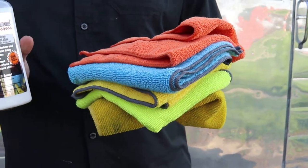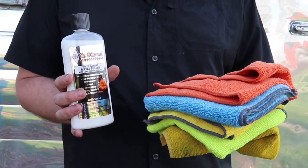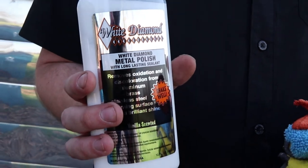Today we are going to polish out the Phoenix Camper. The camper has been in storage all winter, so at the beginning of the season before we get too busy, we do a good hard hand polish. We do that with a bunch of microfiber towels and a product called White Diamond. It's not sponsored, but it has a little bit of jeweler's rouge in it and it's also a sealant, so it lightly scrapes off accumulated grime and leaves a sealed shine — like wax on your car — protecting the bare polished aluminum of the camper.